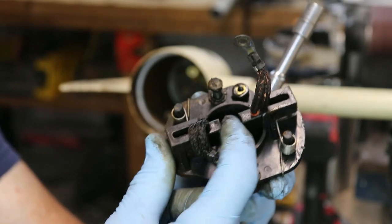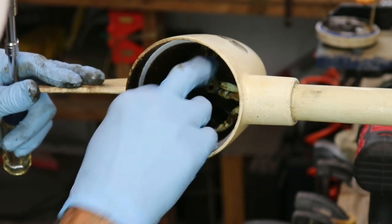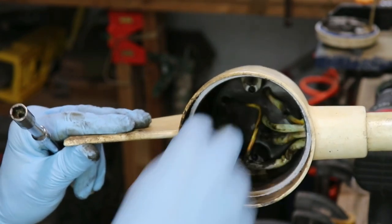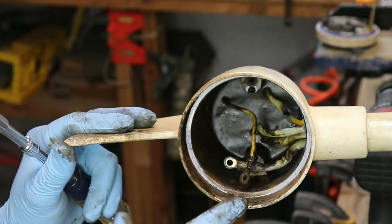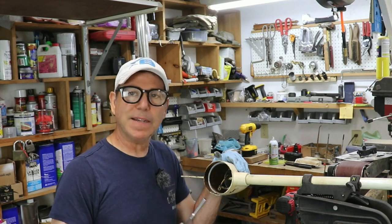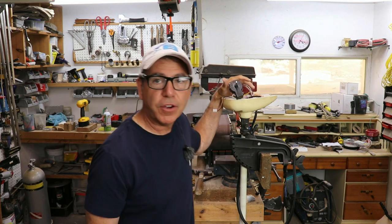Here's the commutator brush assembly. We've reached essentially a dead end — there's a resin casing back there that's actually housing the speed controller. To repair this I'd need the whole tail-end unit with all the wires, which would probably be so expensive it wouldn't be worth it. I will contact Newport and see what they say.